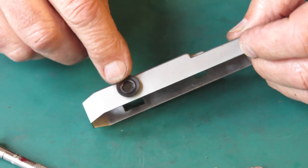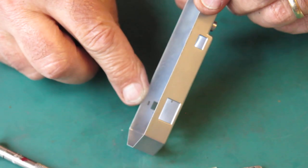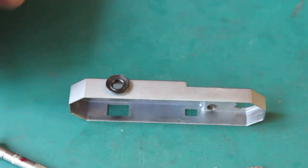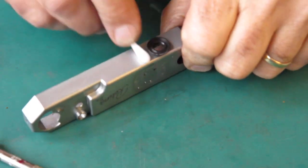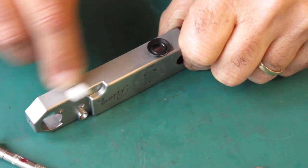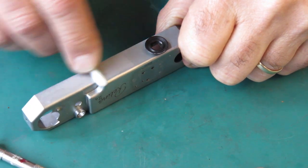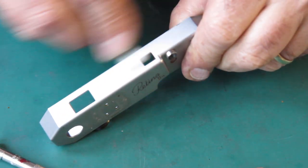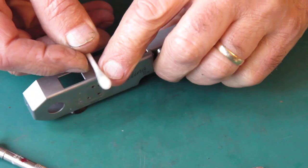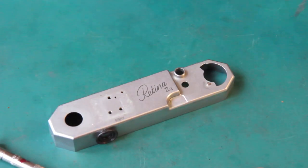The only thing that's in it is the eyepiece here, and don't try and unscrew that — it doesn't unscrew, it's staked in. It has to be cleaned in place. To the top cover, I'll clean this with some naphtha. There's a patch of rubber or something glued on the top there at that point — that's where the film advance lever would have rested.